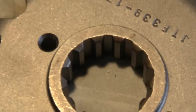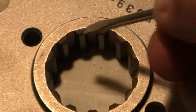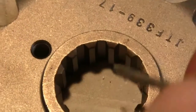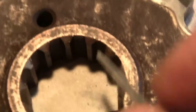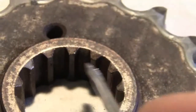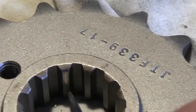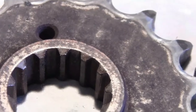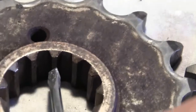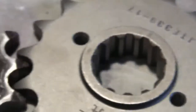That's so much better. It's all to do with the width of this bit here — from there to there. This wall here doesn't make any difference; it's this face there. Now if we go over to this one, you notice the width of this here — can you see it? It's the width of this that is a lot less than the width of that. There's the new one, there's the old one — the width difference is huge. So the reason why this sprocket was loose is because of the width of this shoulder here compared to the width of this shoulder here. Doesn't look much, but it is.